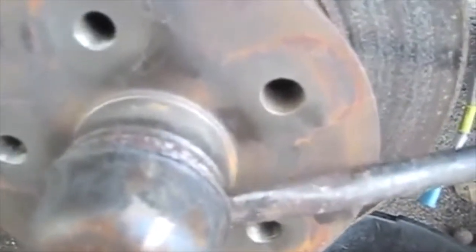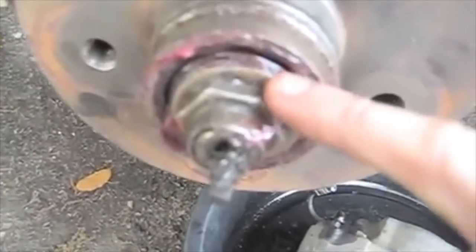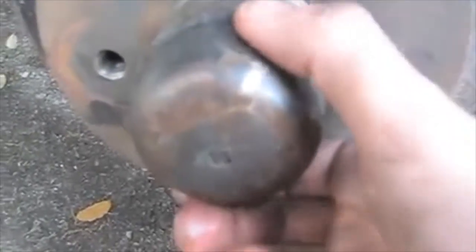Now let's take this cap off. You see this — this is on the driver's side. This is the speedo cable. We're going to take this and just pop the edge, spin it around, keep popping it until it comes off. There's your axle nut and your washer, and there's a little speedo cable. It's not attached to the cap at all — it's just square and fits through the hole. If it seems like it's getting caught, you can push on it, or just pull the cap off and it should come off without any problem.